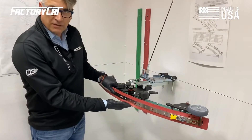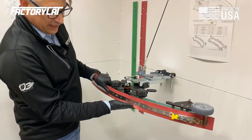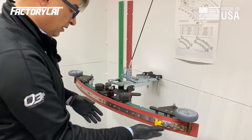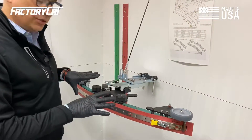Does your machine lay too flat on the floor and smear? Are the tips off the ground where the back is down, or vice versa, where the tips are smashed into the ground and the back is off the floor? You're not going to get great water pickup if that's happening to you, which means you probably need to adjust your squeegee.